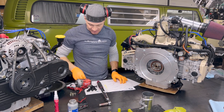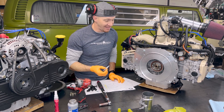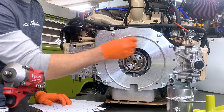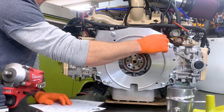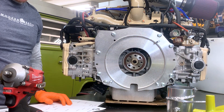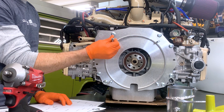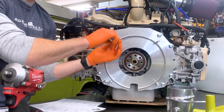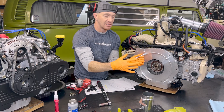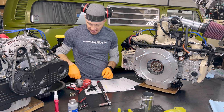I went up to 46 on that - we're fine. Boom, nice and solid, this adapter plate is on there solid. Now we're going to do our little studs. Short, short, short and then long. You may notice as you're screwing this in that it screws in slightly bent - that's pretty normal, you can just get your rubber mallet and bop it in the correct direction if it's not lining up with your transmission mount points. Don't call Kennedy and be like 'hey this is kind of bent' - it's okay, it'll work out.